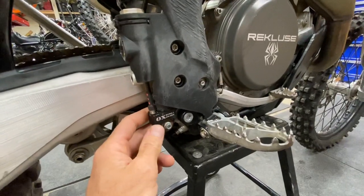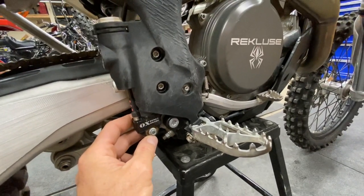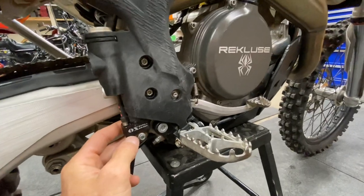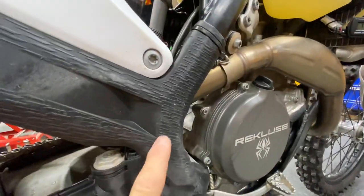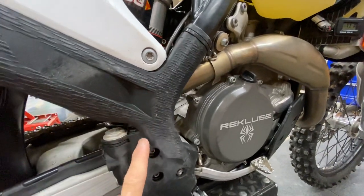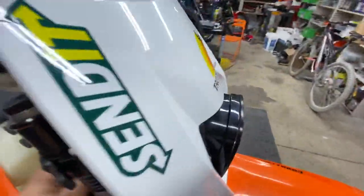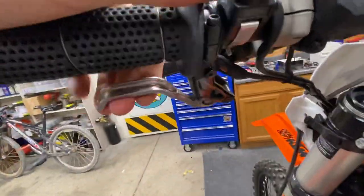Chuck also has a cable-actuated version, but the hydraulic version has much better responsiveness — a lighter pedal feel and more power because it's hydraulic. It's more money but I think it's really worth it. If you're a fan of left-hand braking, take a look at the OX system. You route the hydraulic line up through here, between the frame and the side cover — we trimmed that plastic a little bit to accommodate the cable. It snakes its way up under the tank and up into the bars, makes a little loop and comes up over the top — that's your left-hand brake system.